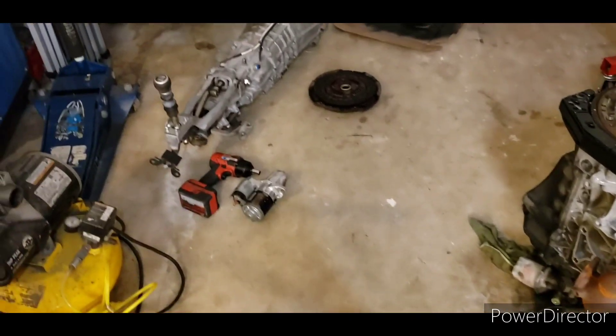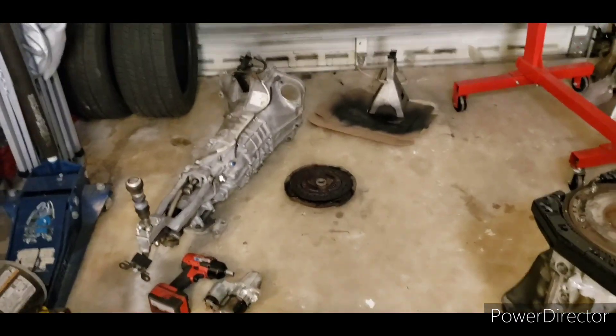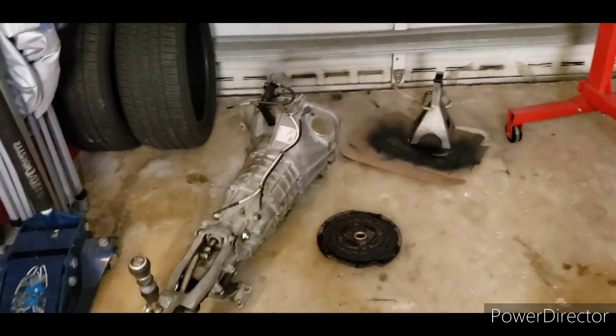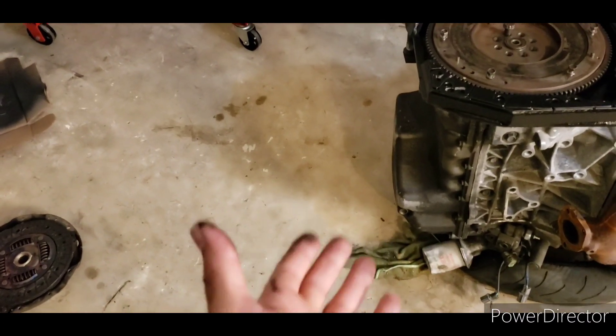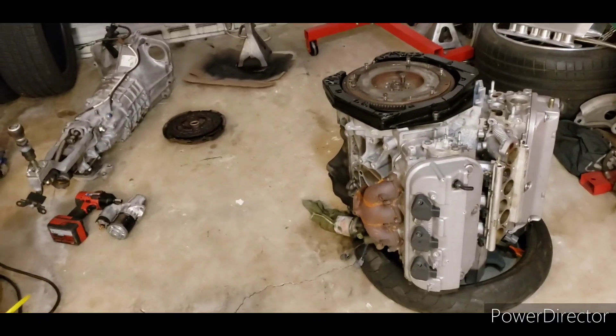The main reason I made my own stuff is because with the S2000 transmission the starter goes on the bottom, and on the Nissan 350Z the starter also goes on the bottom — and I don't like that at all. My plan is to modify my oil pan to be more like a rear sump, because this is going in a truck with independent rear suspension. It's going to be a road race time attack truck.